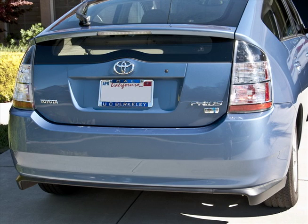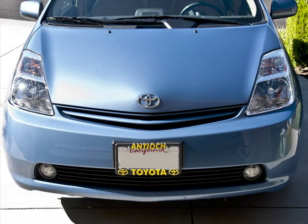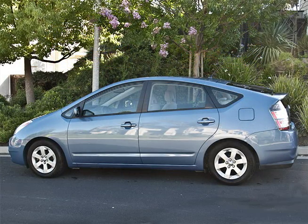Toyota has buried its auxiliary battery deep under the hatchback compartment, and the hatchback door often refuses to open when the battery is dead. Don't worry, Toyota's designed a way to jumpstart the car from under the hood. In fact, this is preferable because you're further away from the battery. More about that soon. But suppose the car doors won't open and you can't get the hood up. Now what?